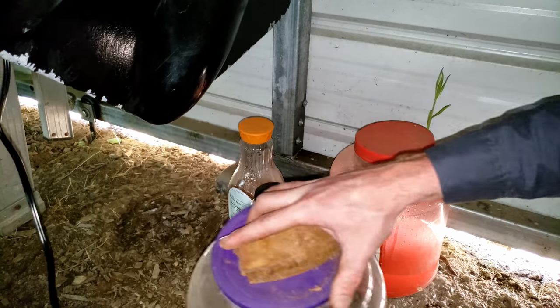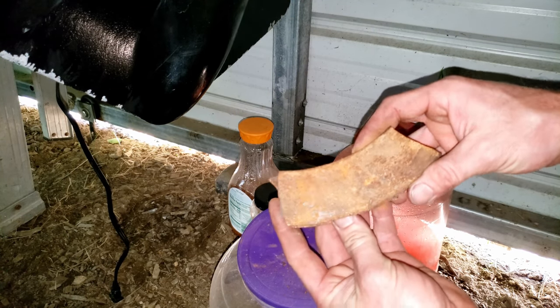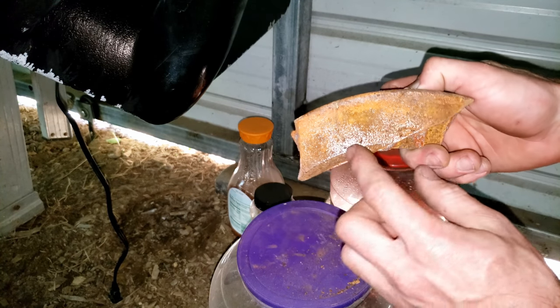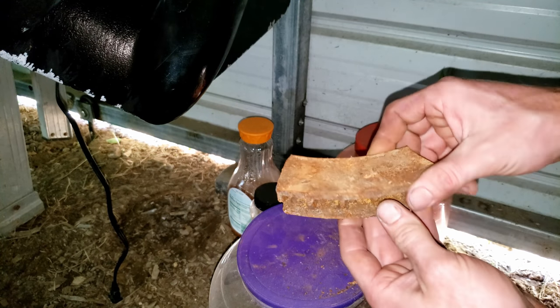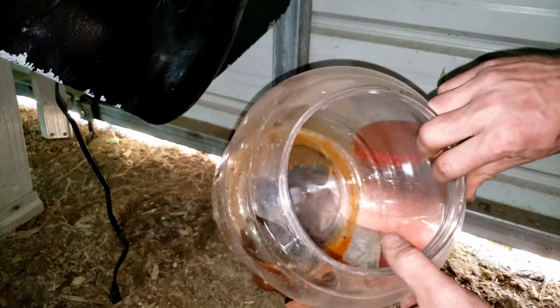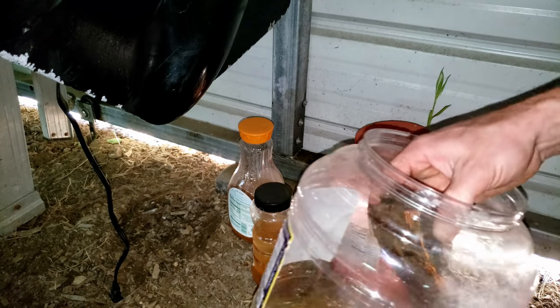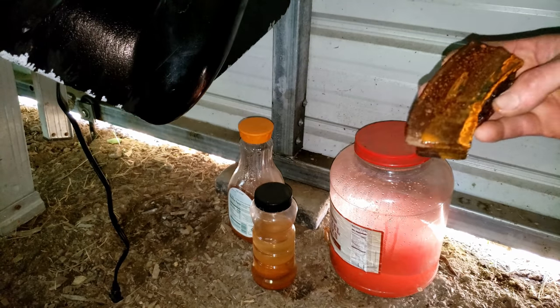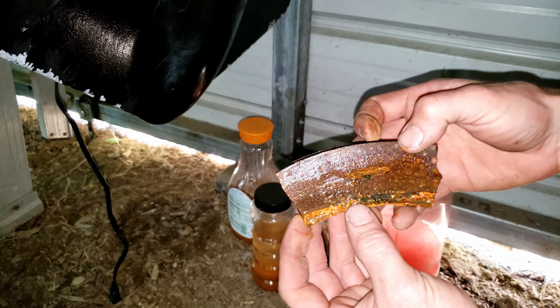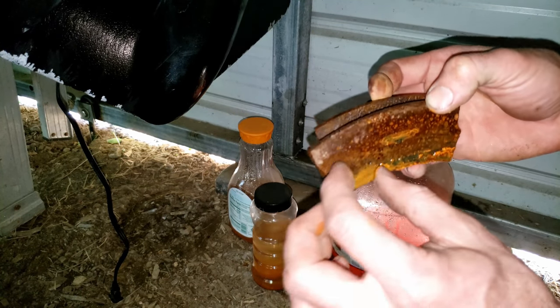Six months later, let's see what we got. They've been stored in the carport, as I said. The one stored dry looks as you would expect — a little bit more rust on the bottom than before. The one stored in the humid environment with the cap loose, there's still plenty of water down there, which gives a realistic environment of what your engine block would be. We can see definitely some rust started down there, but nothing too crazy.